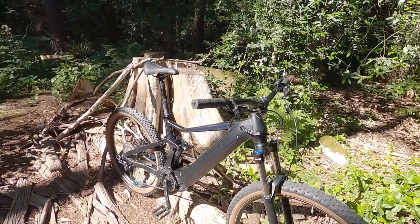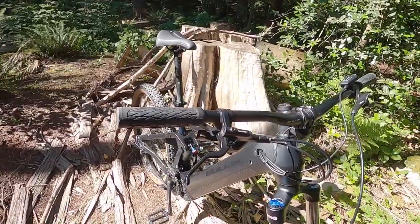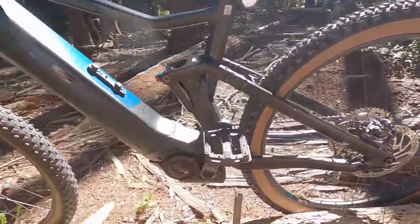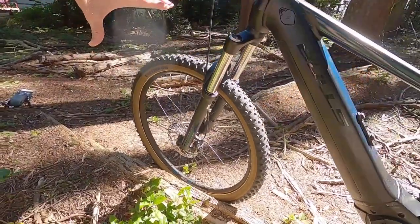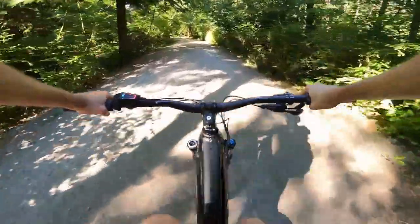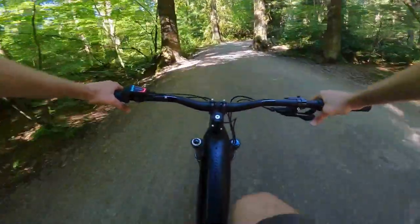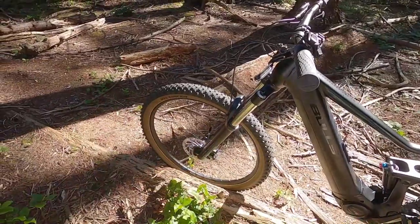What you see here is actually Shimano — three-finger levers, dual-piston calipers, and 180mm rotors. But the brakes the bike will actually come with are Tektro, and I double-checked this with Bulls. You get 203mm rotors, which is much better, especially for a heavier bike and steep descents. It's going to give you more surface area so it can cool more efficiently and a better mechanical advantage over that really tall 29-inch front wheel with 2.6-inch plus-size tires.